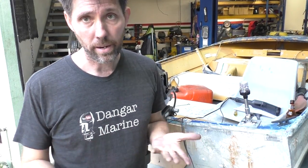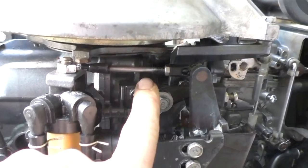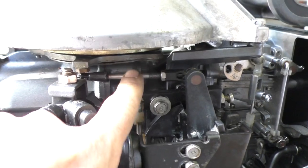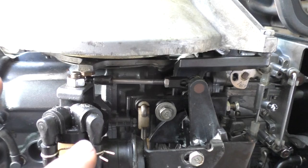Fire it up again and see where we're at. As you can hopefully see, we were sitting at about four or five degrees after top dead centre — means we've got another couple of degrees to go. So what I'm going to do now is lengthen that linkage from the top of the lever to the stator. This linkage here connects this lever to the stator, so if I lengthen this linkage, I'm going to push the stator further clockwise and further retard it.